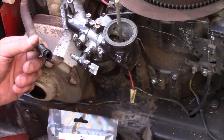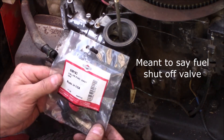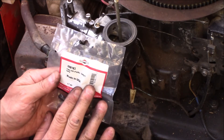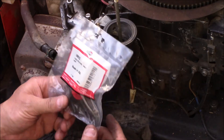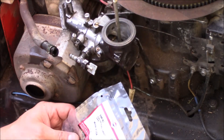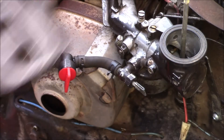The fuel line is pretty old so I'm not too trusting of it. I bought an inline fuel shutoff — Briggs part number 698183. They also make aftermarket ones but those often leak, so you're essentially wasting your money. This is just an extra precaution: install it inline with the fuel line. When we're done running it we'll turn it off. We have the new needle and seat, but this is just an extra safety measure.